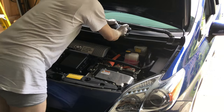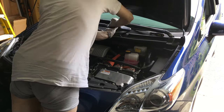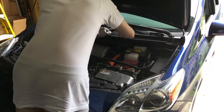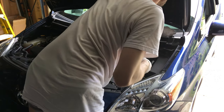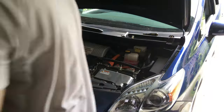I'm going to start by removing the windshield wiper blade arms with wipers. You don't have to remove that cover — I did, and I wish I didn't. Use a 14mm socket. Remove the passenger side one, then the driver's side one. Pop it off — it's spring loaded, so be careful with it.